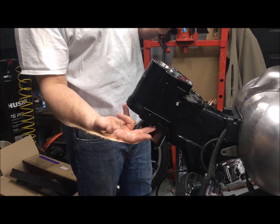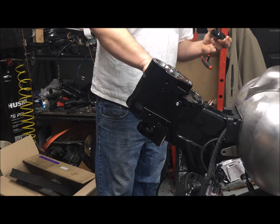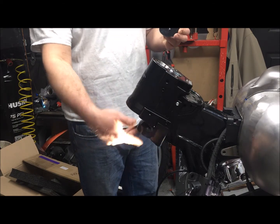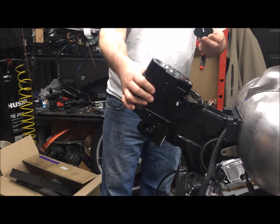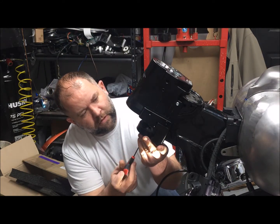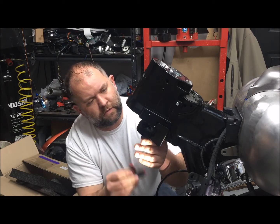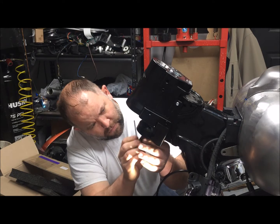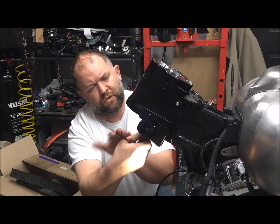We tightened and Loctited the 4 bottom bolts. We tightened and Loctited the 1 through bolt. Loctited and tightened the bottom stem bolt to 100 foot-pounds. Added a stem bolt and a washer to the top to lock the entire unit in place. Now we're going to put a cover plate right up in there, with some blue Loctite on it.